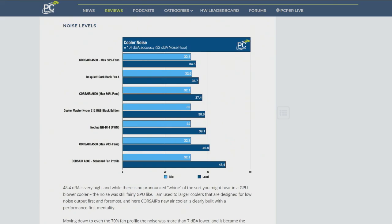At 50%, it was quieter than a Be Quiet Dark Rock Pro 4, quieter than an NH-D14, and quieter than the newer Cooler Master Black Edition — none of these are loud coolers, but the result was very, very quiet. So you could figure out a nice trade-off between noise levels and thermals with this thing. But it's still a big ask to say you can play with those trade-offs when it's $100, and you could spend less money and get better thermals and lower noise with the Be Quiet Dark Rock Pro 4, which is $10 less, had the lowest temperatures of the group by about a degree, and was also the quietest out of the box.